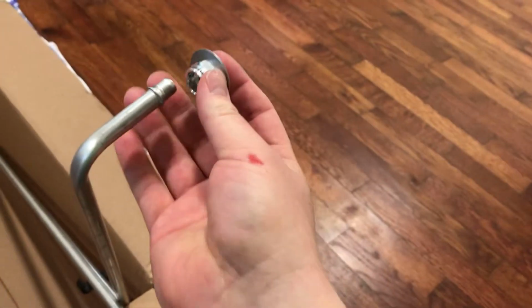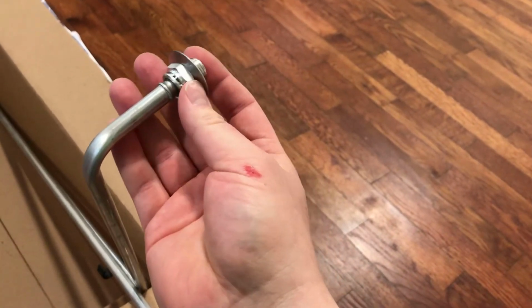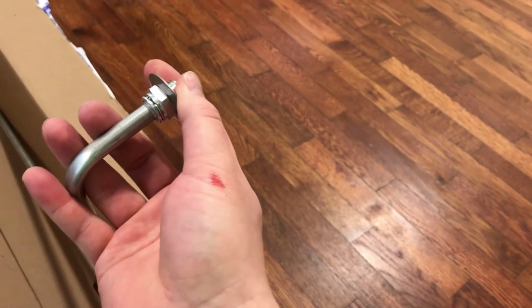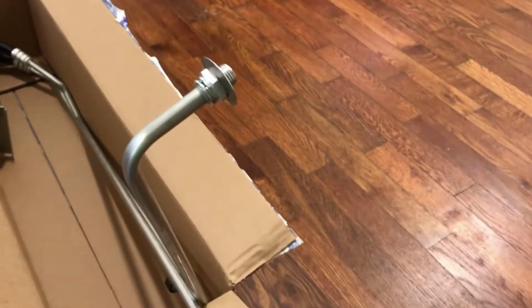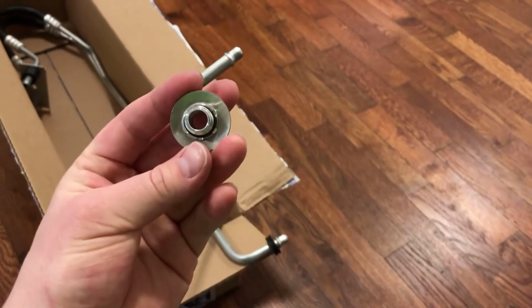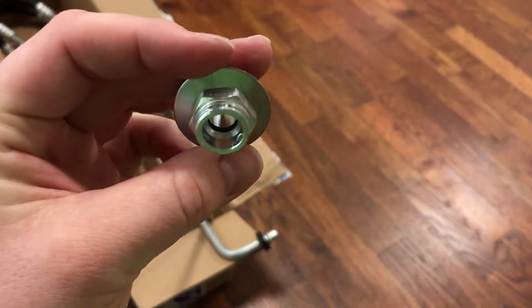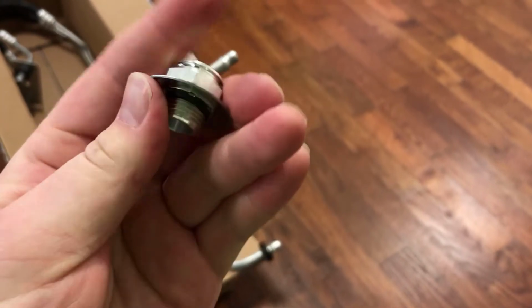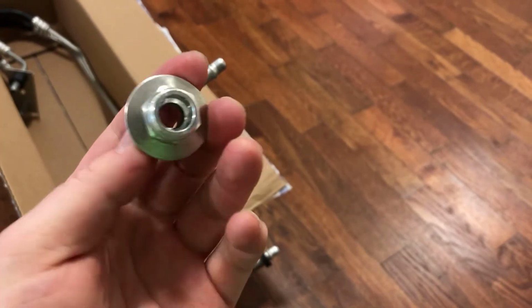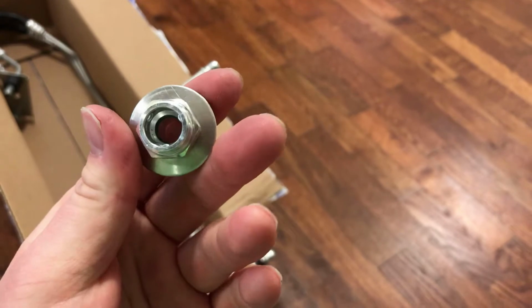Again, quick connects, even though it says quick disconnect on the fitting boxes. Not very quick to disconnect. Anyways, so then you're gonna slot them in like that and give it some pressure and it'll clip right in. I'm not gonna do it right now because I'm gonna do it on the vehicle. I would also lube up the O-rings with a little bit of transmission fluid. There are two. There's one on the inside and there's one on the back here. That's another reason why you should replace these, is because you've got two O-rings here that could fail in the future.